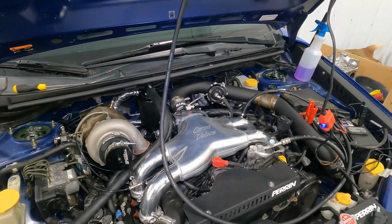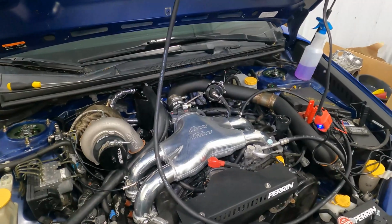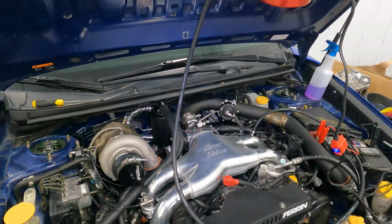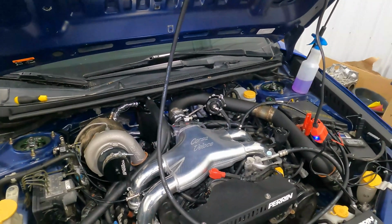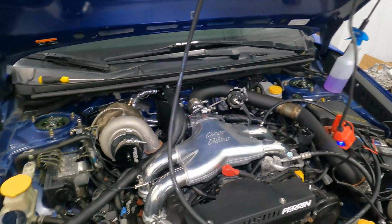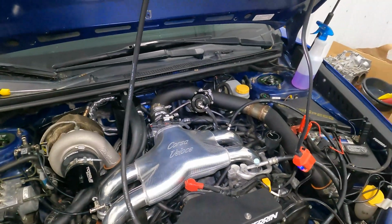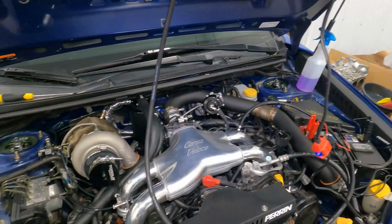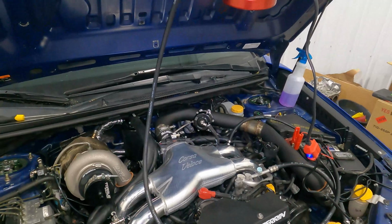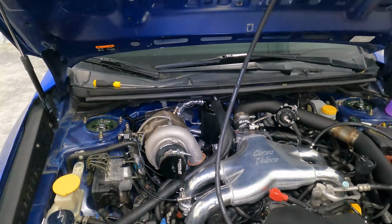I'm gonna have to probably put together a bottle of soapy water and spray it as we put air to this. But we ruled out the vacuum side basically. So everything as far as all the lines and gasket areas like the TGVs, all that is good. So I'm gonna pull this smoke machine part all apart, and then we're gonna test it under pressure on this one.